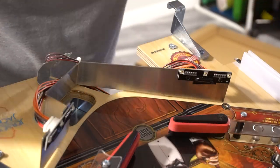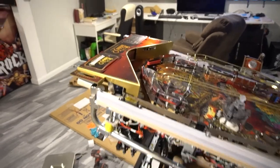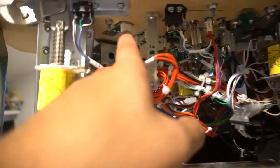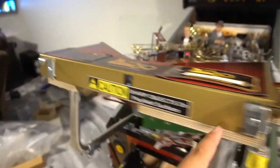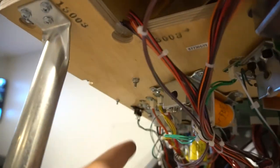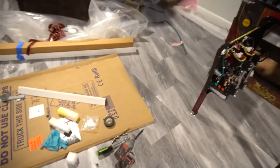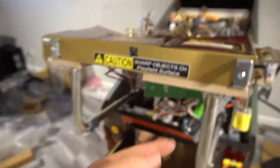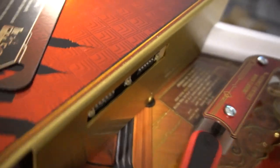Let's put the apron back. Alright guys — apron is back on. You've got that one nut there, the two screws right here, and the other nut on the left. Total time, about 30 minutes — that's because I don't have the right head for the lock nut. I used pliers and slow and steady wins the race. Now you can't even see the pins because the electrical tape is on it.